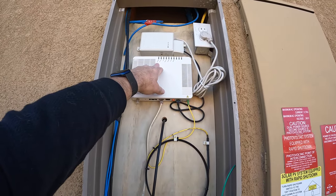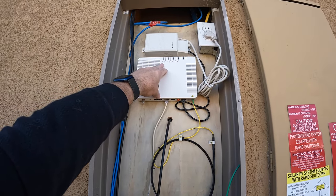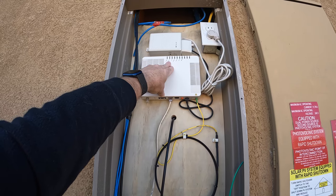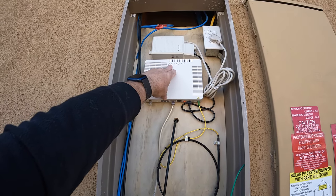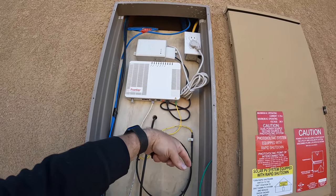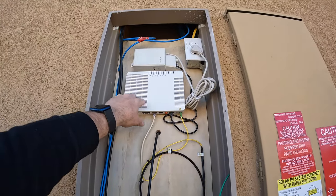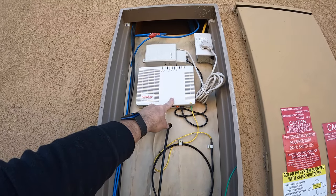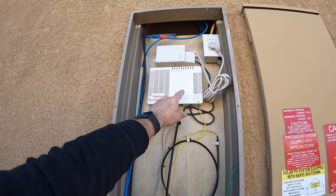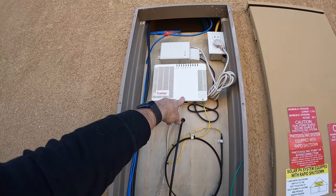What's going to happen is a slow process — the power comes on after a few seconds, that'll blink quickly and everything seems normal. It'll stay dark for a minute or two, about 15 seconds of activity, then the optical comes on but blinks slowly. That's the optical sync between here and their head end. Then it gets its IP address — this is your wide area network interface IP address. When you look at the WAN address of your router, it's the address that this converter got assigned.